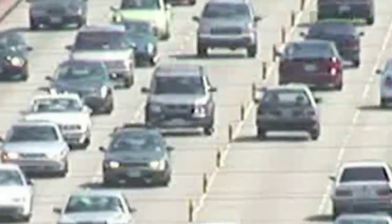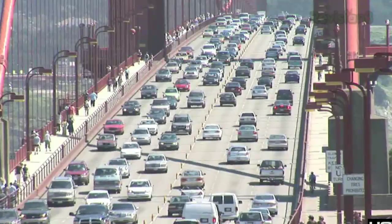What won't it do? You're not going to turn low-grade standard def video into something that looks like a well-authored Blu-ray movie. It's going to scale it better than anything else that most of us can afford. If you notice some slight block artifacts in your signal from your cable or satellite subscription in a particular program, it could help adjust things like that. If you're dealing with mosquito noise and text on screen that drives me a little crazy, I can dial that down. What about giant swaths of compression artifacts from satellite compression? I have a channel at home that breaks up constantly, and there's only so much you can do. If the whole picture's breaking up, don't expect miracles. And likewise, don't expect a low resolution video source to be scaled up to something that looks like a pristine Blu-ray transfer. That's not going to happen.